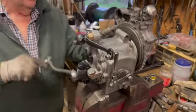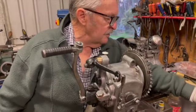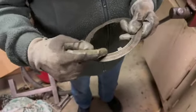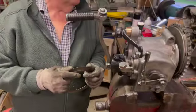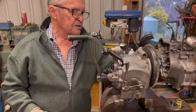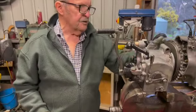And in the clutch also, Ian's clutch plates that he had, even the spare one, these from his spare clutch, these are the really old type. And one of these had one of the tangs broken off it and so on. So I had some spares, new modern slotted ones, so I fitted them into that clutch as well. So that should be good. And I had a new old stock thrust race, which I've also put in it.